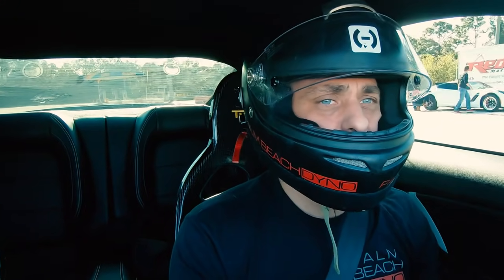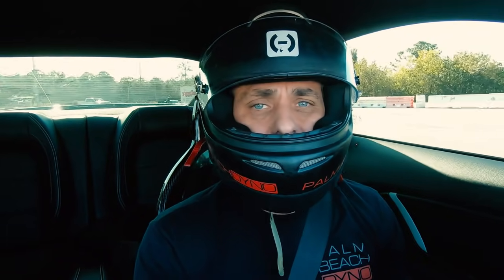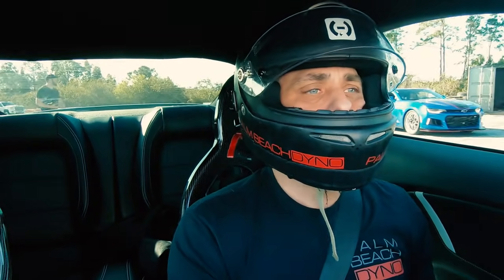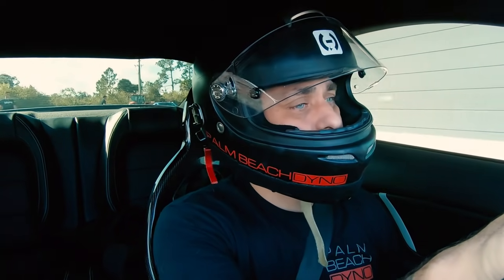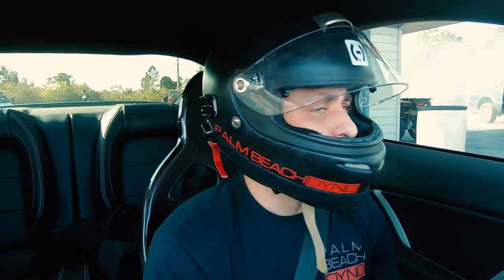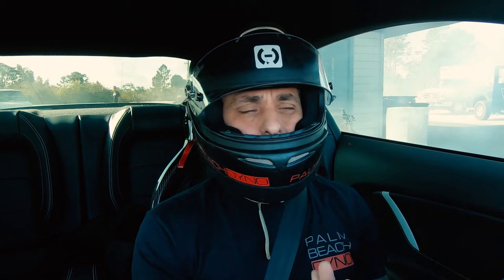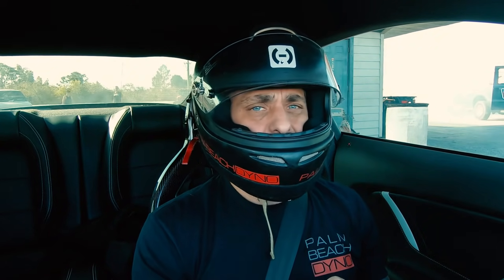So let's go ahead and just see what it does on a bone stock tune, with the modifications that I mentioned. Okay, hopefully you guys can hear me pretty good. I'm going to go ahead and run the car. The car is on the stock tune, and I am going to run it in drag mode at 3200. Because we have the Mickey Thompson drag radials on it, I figured we'll go right to 3200. If we happen to spin, I'll back it off a little bit, but I don't really suspect that.